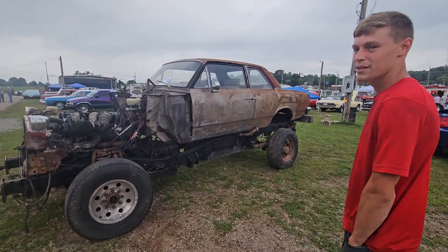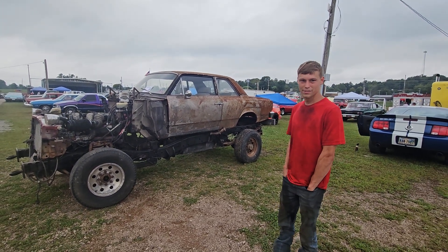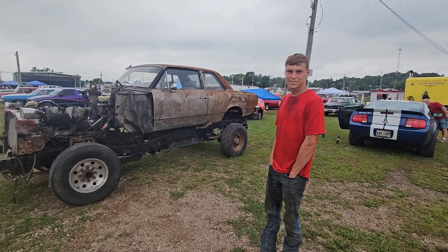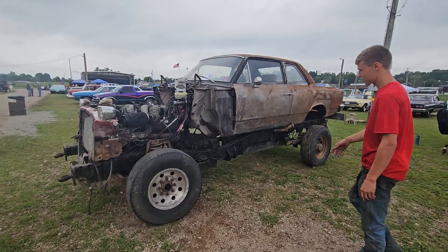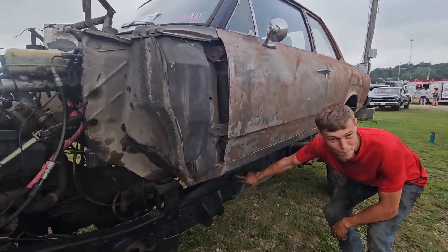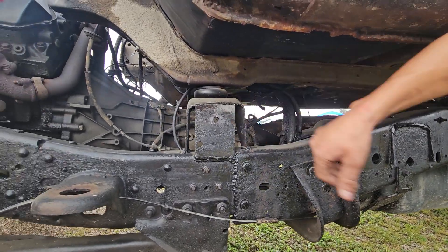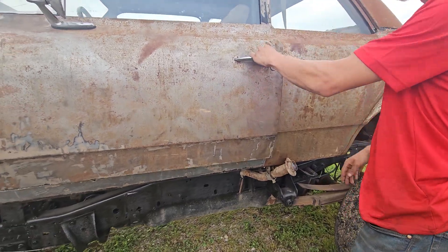Like I told you a little bit ago, what makes it look so cool — you guys were talking about channeling it, putting it down, cutting it in the floor — but it looks like it shouldn't be on there. It looks like somebody just out in the junkyard set this on here for now. I mean, that's what makes it look so cool. I just cut the factory cab mounts off the frame, flipped them up there, put a little gusset on, welded them on there, and bolted it through the body. And I did all the dash harness too.